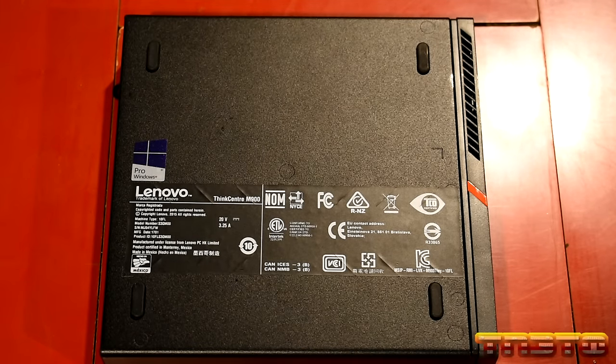Okay, guys. So MemTest86 has finally completed. It took about 4.5 hours to complete, which is pretty crazy, right? But we were testing 32 gig of RAM there. It does take a while to do these tests because it will do four different passes. So it's really in-depth. As you guys can see, we did pass MemTest86. That means our RAM is good, which I had high confidence. I mean, it's Crucial RAM. We're not likely to have any issues if we buy quality RAM.